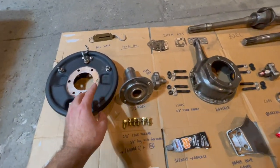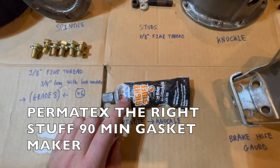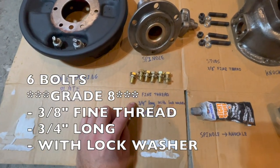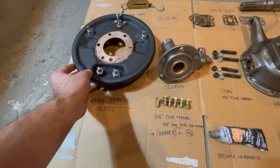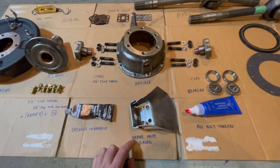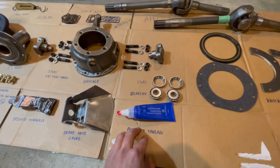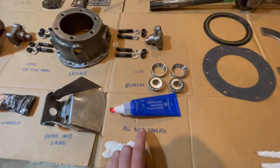Moving left on our board we get to the other side of the knuckle where we'll install the spindle directly onto the knuckle using the Right Stuff 90-minute Permatex gasket maker to prevent oil from leaking between the spindle and knuckle. To attach the spindle there will be six 3/8 fine thread 3/4-inch long bolts with lock washers — make sure they're grade 8, that's very important. The backing plate installs directly onto the spindle; those bolts go right through the backing plate through the spindle and thread into the knuckle. On early CJ2As a brake hose guard is installed on top of the king pins to protect your flex line. For any bolt threads exposed to oil inside the knuckle, make sure you use Permatex anaerobic gasket maker to prevent oil leakage through your bolts.